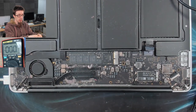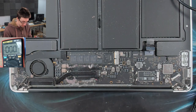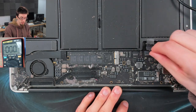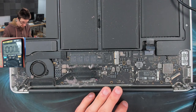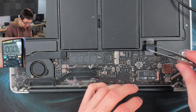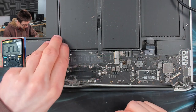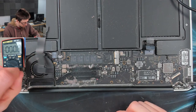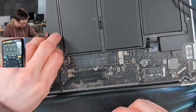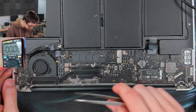I'm going to take the logic board out of the laptop so we can get a look at both sides of it, because this is likely to be a more complicated one. Battery's already disconnected. I'll disconnect the screen and then unplug the antennas for the wifi card, the keyboard backlight and the keyboard, the ribbon connector to the IO board or DC board, power from the DC board, and the webcam.